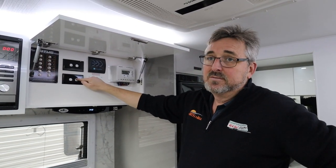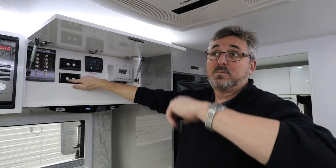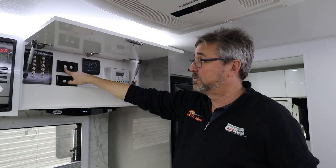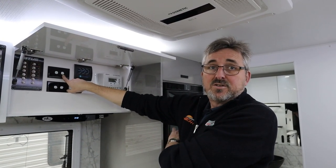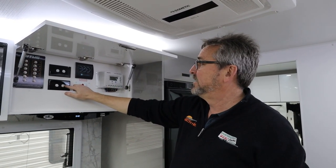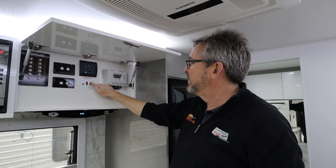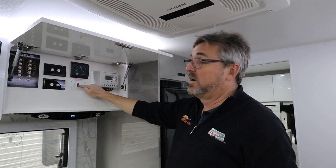These switches are all labeled so you can turn stuff on or off to save power. Aircon - it's an isolator, so it can't come on by accident if it's up. Your water pump: if you're using your tank water, pump switch down. If you're using hosed water and you've already got pressure, leave it off. Your fridge control - if you turn that off, your fridge turns off. Your fridge runs on 12-volt only, so you want to make sure it's working. Your hot water service - you've got three switches for it. This turns it off completely, and then you've got switches to turn it on. That one is your electric switch, that one is your gas switch. I've now turned them both on because I want water to catch up in a hurry. If you see a red light, you've got a problem.